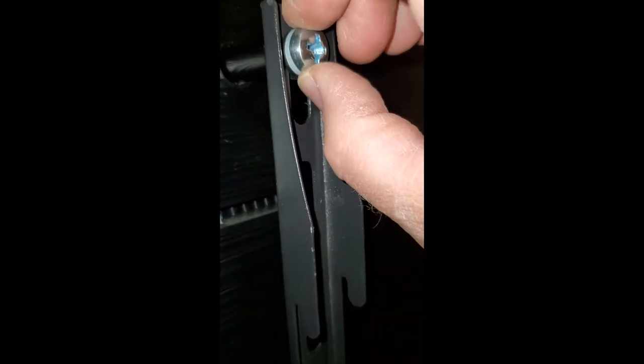This is a Samsung 58-inch TV. I've got two washers on here — I'm hand tight and I think I'm almost at the back of the threaded area, so I'm going to put one more washer on there and put a regular washer on top. I actually added a washer on the inside — I've got two nylon washers, a black and a white one. I did that because I didn't want to bottom out the screw when I tighten it up. I wanted to have a little bit of give and still be tight.